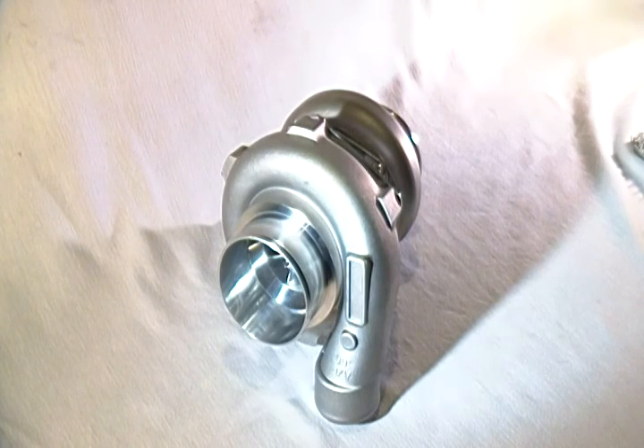The purpose of the turbocharger is really two-fold: to work with smaller displacement engines under 1.8L that want to maximize torque while retaining upper-end power, and to work better overall with smaller displacement engines. For those using these as a twin set, especially in smaller displacement V8 and V6 engines, this slightly larger turbocharger offers good drivability and transient response while allowing boost pressure increases for upper-end power over 800 horsepower.